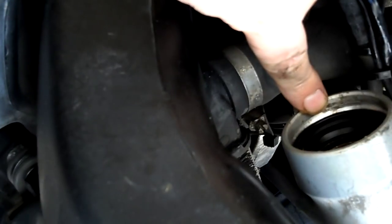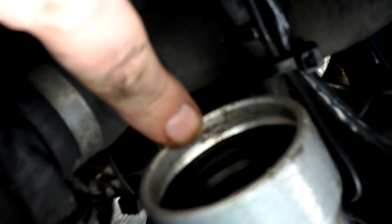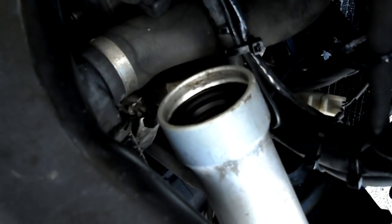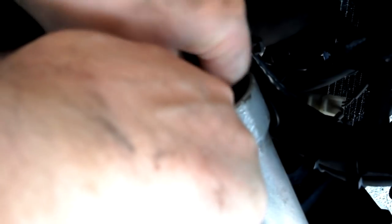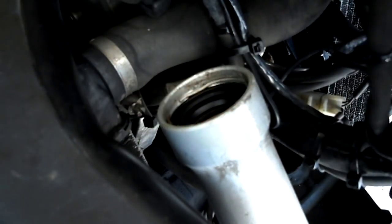How do you know it's in the right position? When the circlip groove is visible all the way round — just put your fingernail in there and run it around the top of the tube. As long as the circlip groove is clear in all directions, that's as far down as the seal needs to go. It's as simple as that. Next, get the circlip washer — probably not its proper name but the best description for it — and clip it back into the groove above the seal. Make sure it's properly in position, not half in and half out; it needs to be absolutely in the groove all the way round.